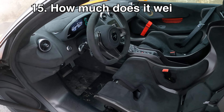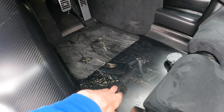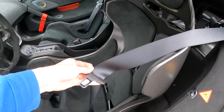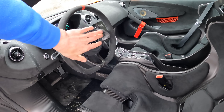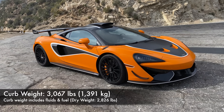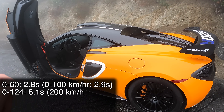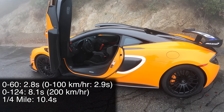One of the things I love that McLaren does is put a very large emphasis on weight reduction. You can see the exposed carbon tub underneath, the carbon bucket seats — it's a fairly stripped-out interior. You do have a six-point racing harness as well as a standard three-point seatbelt for road legality, and there is an airbag you can't deactivate, though it won't impact your safety on the track. The overall curb weight including fluids is just over 3,000 pounds, and this is making 611 horsepower — incredibly quick, with 0-60 in 2.8 seconds and 0-124 mph in 8.1 seconds.